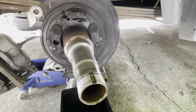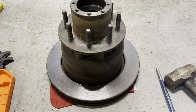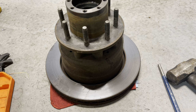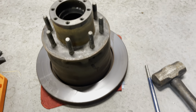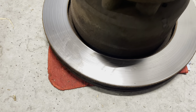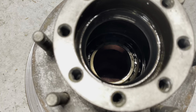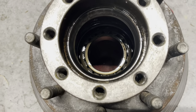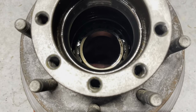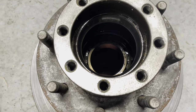Move inside and start working on the rotor, hub, bearing, and race assembly. To work on getting the rotor separated from the hub assembly, start by putting the rotor flat on the ground — if you're reusing it, put something underneath it. If you're changing the bearing, use a seal puller; since we're not keeping it, we'll bang the seal and bearing out together, then bang the race out as well.